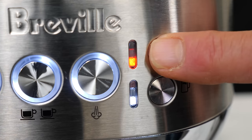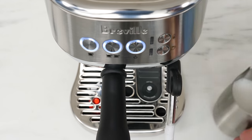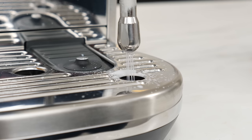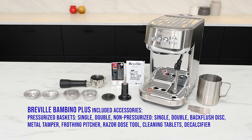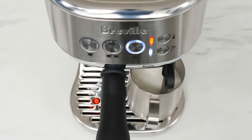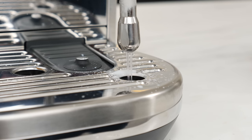While you can froth milk manually, the Bambino Plus can do it automatically with user selection of three temperatures and three froth densities. Place your pitcher on the deck, set your temperature and froth type, then press the steam button and the machine does the rest. A temperature sensor on the drip tray stops frothing automatically when up to temperature. Remove your pitcher and lower the wand and it purges automatically — that purge pushes out any residual milk from the wand. Whenever milk is frothed, you should always purge your wand before and immediately after steaming. The Bambino comes with accessories including a usable tamper and milk pitcher, which must be used with the automatic frothing feature. Automatic frothing with three temperatures and three froth density options is nice, and you can still froth manually if desired.